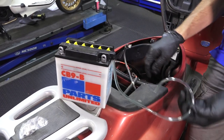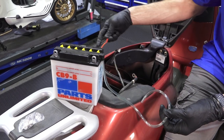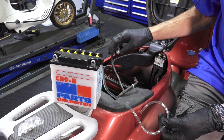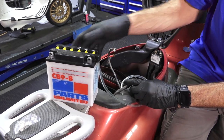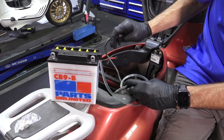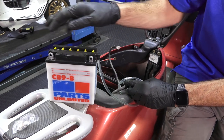This battery tray is kind of unique — it's got two positive terminals: one that's for the charging system and one that's for the starter, and a single ground, differentiated by a little plus or red. So if you see red or plus on the wires, that's your positive going to the positive terminal, and the black — the one that usually leads to the frame of the scooter — is going to be your negative terminal.